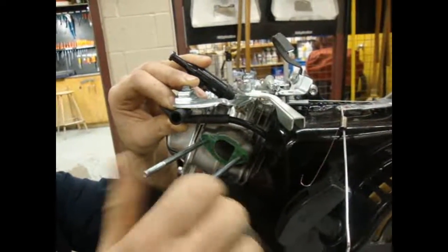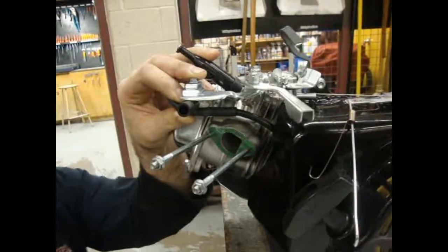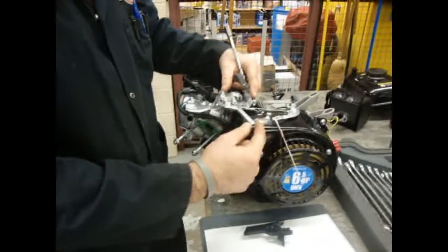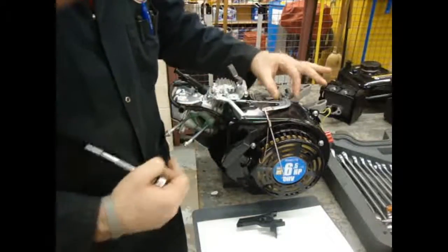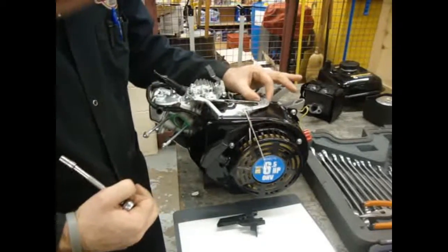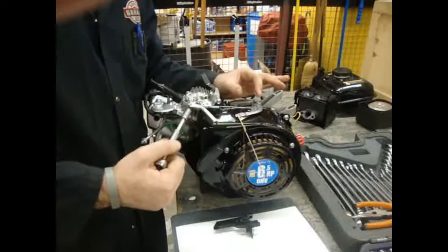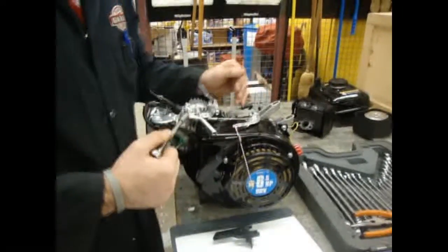I'll take my nuts and place them on my studs so I won't lose them — I know where they belong. Now we're going to remove this bracket over here. This bracket is the governor bracket — it has to do with the throttle and how fast the engine will run. We're going to remove this bracket and the spring from it. This other bracket here, guys, we're going to leave it be. We're not going to remove it or adjust it — this has to do with the governor. A couple of students in the past removed it and didn't put it back in the exact same position, and then the engine had a problem with its idle — either too high or too low.